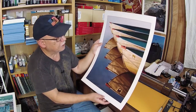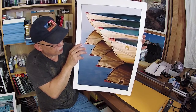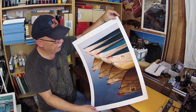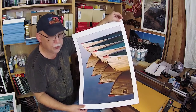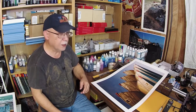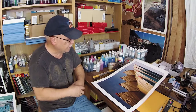As you can see, this is very nicely printed. This seemed to work on the 3880 — I did not get that over-saturation of ink. I think it's an ink density problem with the P800 causing the buckling, which causes the head to strike in areas where the paper should be flat. The printhead literally scrapes the coating right off. Baryta papers are very fragile and you need to treat them gingerly — any unevenness of curl or buckling will cause head strikes. At this point I'm happy with these results and will dedicate the 3880 to print on this paper.